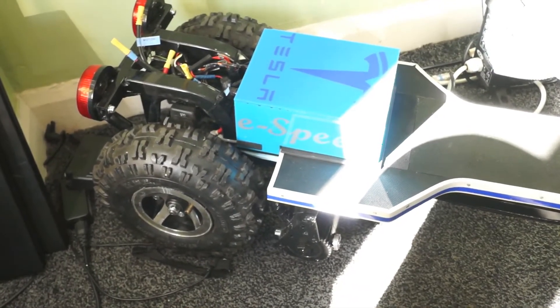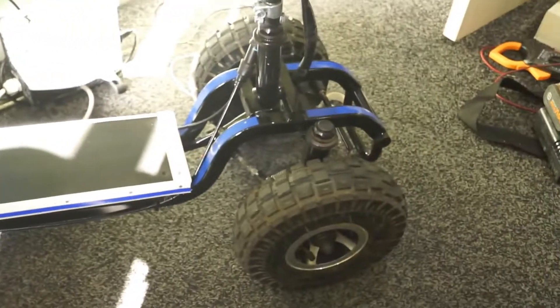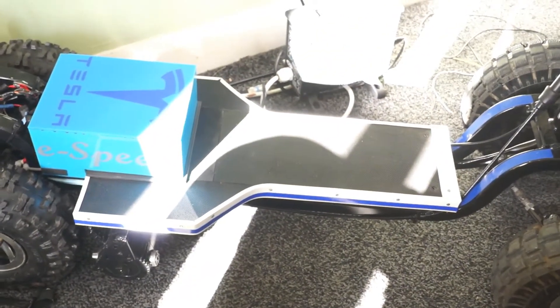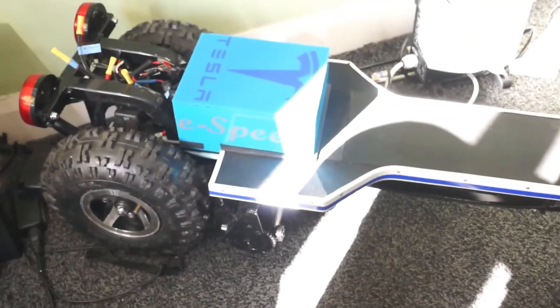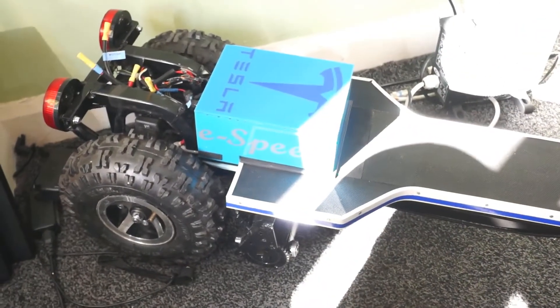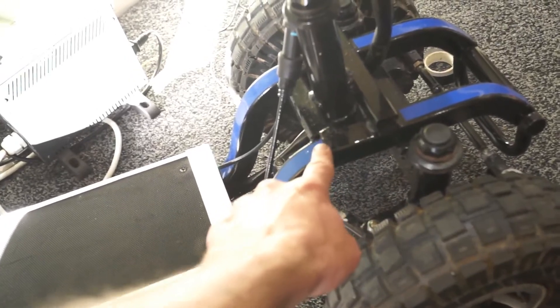I've actually ordered four new tyres because these big knobbly ones - I think you're going to feel every bump when driving. I've ordered two to start with because the front ones are rotten and need replacing. The running boards are done and it's plastic trimmed - all stuff I had lying around in the shed. I've noticed the front wheels are roughly an inch to an inch and a half lower than the back, so I need to raise it. If it all works, I'll cut it here, put in a bit of box section steel, and lift it up to make it level, which will also lift the motor a bit further off the floor.